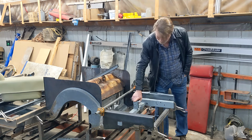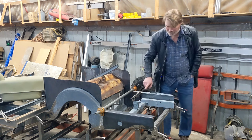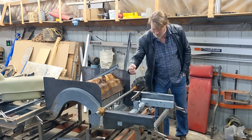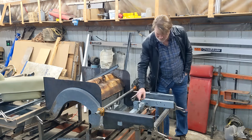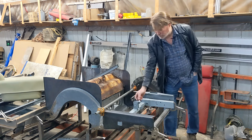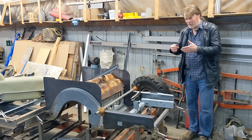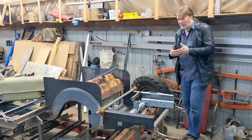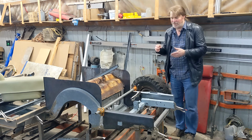The park brake bracket, the metal loop was rotted out. There were holes through it, it was too thin, and there's quite a bit of strain on that side to side if you pull on the handle. So I replaced that, but I was able to save the two washers and this little hook piece that comes out here. The washers have little divots driven into them. They make bulges in the backside, so when they welded them to the plate, those little bulges welded on. And so I just drilled through the divots and knocked the spot welds out the back. Cleaned them up.